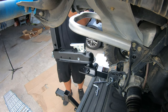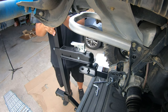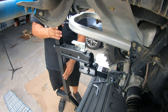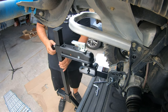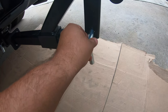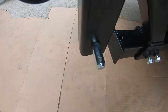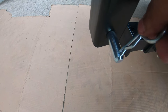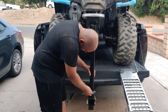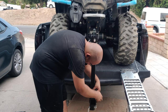Slide the vertical long tube through the ball coupler and the housing weldment. On the bottom side of the vertical long tube is a hole to secure the pieces using a bent hitch pin. Slide the long tube so the hitch pin is just below the housing weldment, and tighten the slip handle to hold it in place.